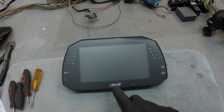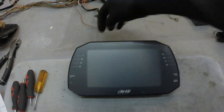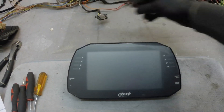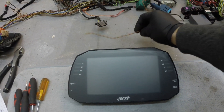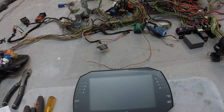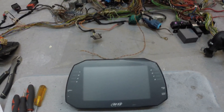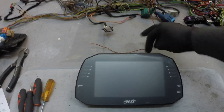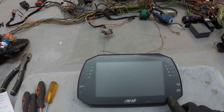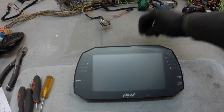I decided to go with the AIM MXG seven inch dash display. The coolest feature about this is using these two wires here - it's the factory CAN system. This is basically the communication line between every module in the car. It goes to the comfort module, to the ECU - everything is connected to it, the gauges, everything. It's basically your link to talk to everything through the OBD2 port. But also I can hook this up to this dash display and it will then read every bit of information that the ECU reads - all the sensors on the motor will display on here through these two wires.